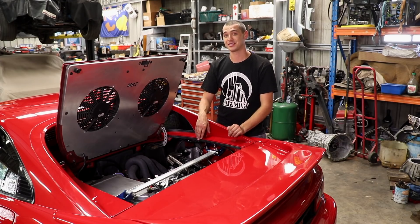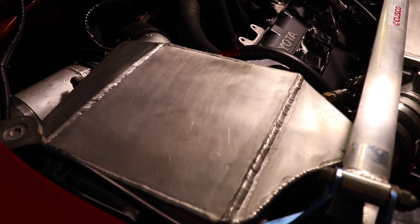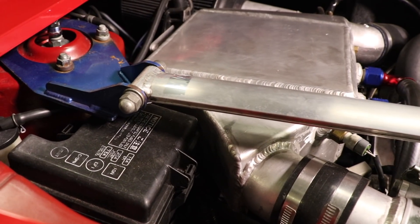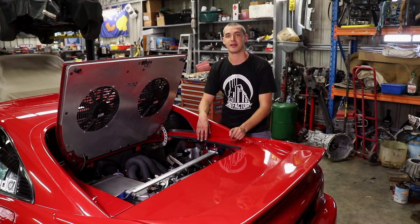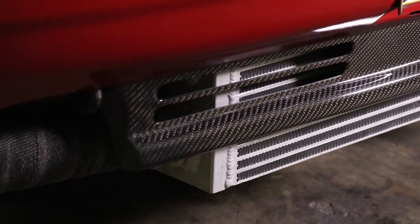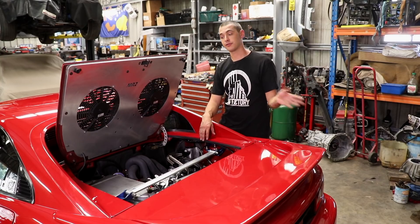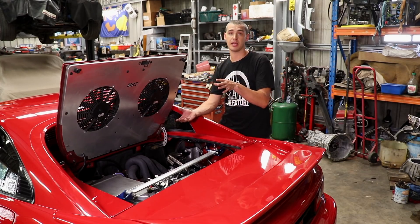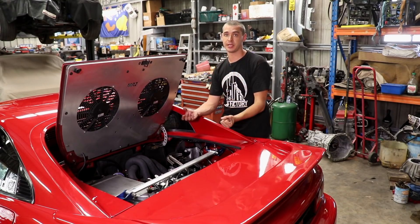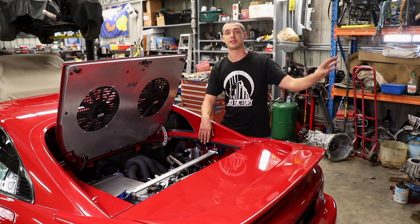The water-to-air intercooler is actually just something purchased off eBay. I then had Matt Tomasini — our good friend with the twin-turbo LS Skyline — fold me up an alloy tank, which I then welded on. My TIG seals aren't the best but I still get the job done. I mounted a heat exchanger under the back of the car. The way the water-to-air intercooler works is there is coolant running through the system — instead of an air-to-air system, the water in the intercooler draws the heat away, then travels via a water pump down to the heat exchanger which dissipates the heat.